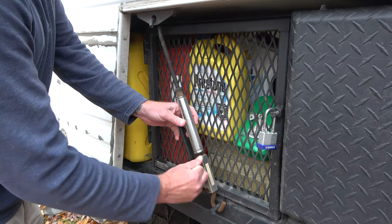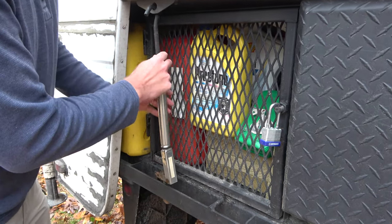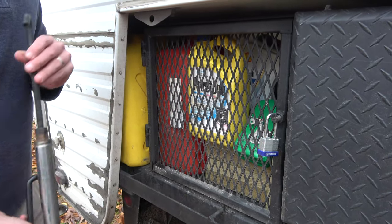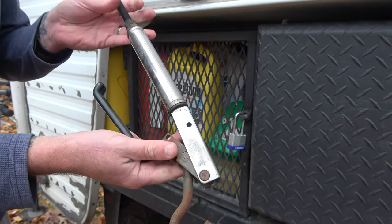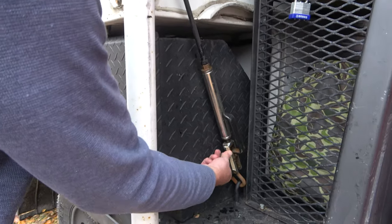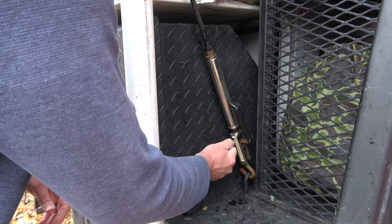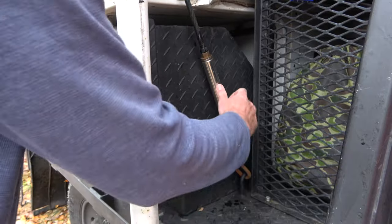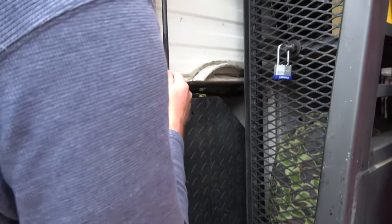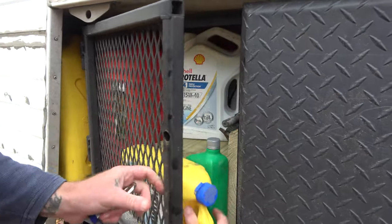The third step is going to be to remove the tie-downs. This is going to be different for every setup, depending on what kind of tie-downs you have. We use Happy Jack Quick Load Turnbuckles — these are spring-loaded turnbuckles that allow for a quick release when putting the camper on and off the truck. Note that because we have a flatbed truck camper, our tie-downs go to the camper bed itself and not to the truck frame. With a standard truck, you will likely have your tie-downs tied to the frame of the truck.